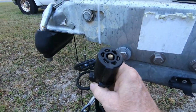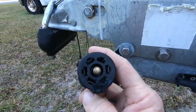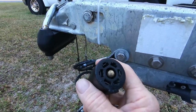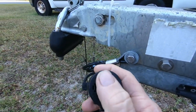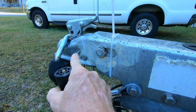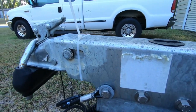So this is your seven-prong plug. The center piece — that little golden piece right there — that is your connection to your backup lights. When you put your truck in reverse, this sends a signal back to your solenoid here, which cuts it off from putting the brakes on, so when this slides back, your brakes won't engage and you're able to back the trailer up.